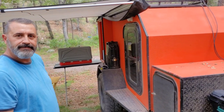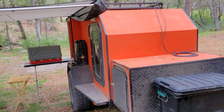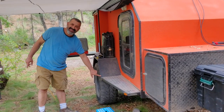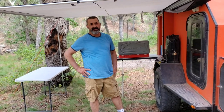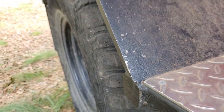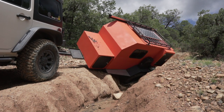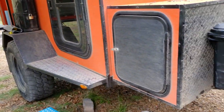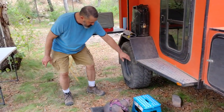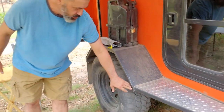In terms of sturdiness, even just getting here today on a gnarly trail there's been essentially no damage — with the exception of that one suspension part that failed, which was oddly the only component not made by hand. Everything else has been rock solid. This trailer has actually been on its side once; it leaned on the rail, which is inch-and-a-quarter by quarter-inch aluminum, and the top bar is two inches by quarter-inch — welded all the way to the frame. It held together completely.